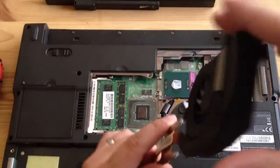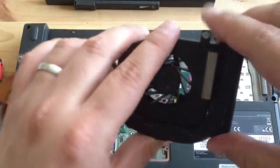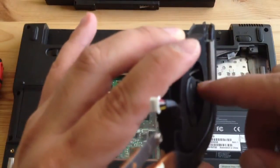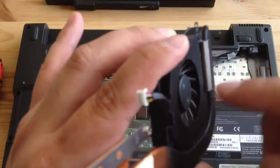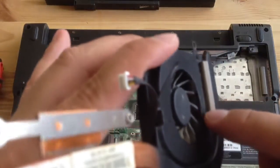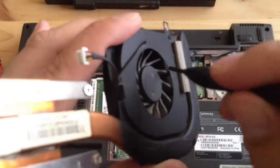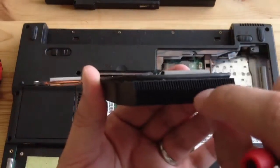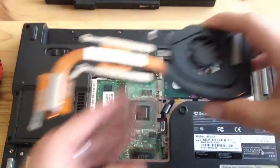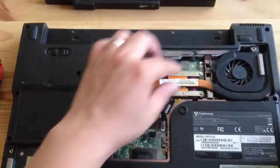There was some kind of metal thing attached that I had to clean off. You'll need to clean these fins out — you can use a compressed air blower. In my case, I just took a toothpick and pulled out the dust bunnies from inside. If you look inside you can see how dirty it is. You can use a small screwdriver to pull out the dirt, then blow compressed air. I like to use a vacuum, but most people wouldn't suggest that because of static electricity concerns.